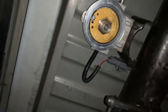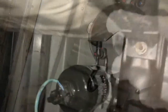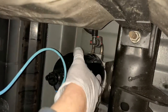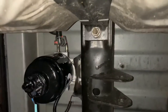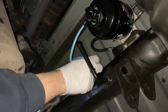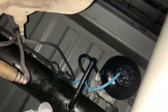I'll wipe it down, take my new filter, get it started on there — you can see it going on. It's hand tight now, so we're going to ratchet down and make it filter-wrench tight. Now that it's tightened with the wrench, I've got to plug the connector back in. You hear it snap — it's in there. I'll tuck that cable out of the way.